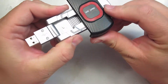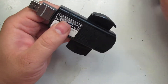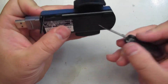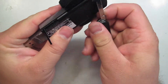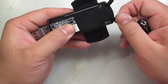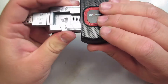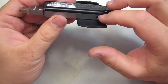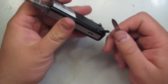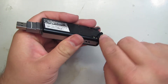Well anyway, there are no screws on this. These little port covers only cover the access for the SIM card and a couple of antenna connectors. There are no screw holes, so getting into this is going to mean popping right along here. Since I don't have a proper spudger yet — and believe me, it's on the shopping list — we're just going to use the pen knife.